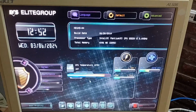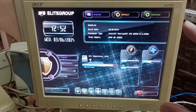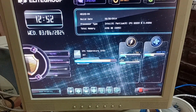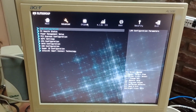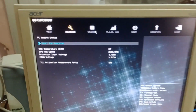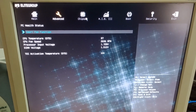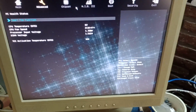So, yeah, aside from not trusting all the readings, maybe taking the first read and after that just showing that. But we can see the voltage, we can see everything, and it seems to be in working order. Again, we can see here that it's reading the RPM from the cooler, the voltage, and the memory, but it's not updating the temperature for the processor. So I think it's maybe a problem with my makeshift cooler. I can reinstall this to see what happened, but in theory, we have a working machine.